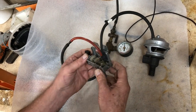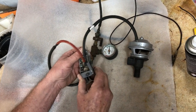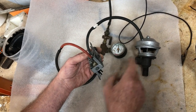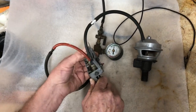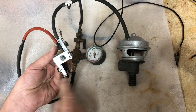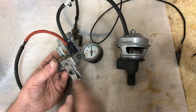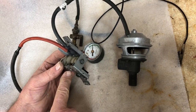As we turn the camshaft on the adjusting knob here, we can see that the cam activates this tower and lifts the pin, which allows vacuum to go into the system. As the cam rides up it lifts the pin, and you can see it has actually opened the valve. It's going to open the valve in a varying degree depending upon the temperature of this bimetallic strip, which is adjustable right here.